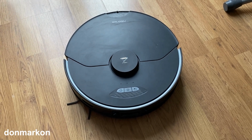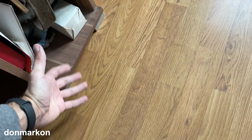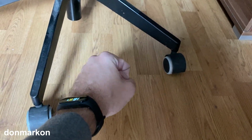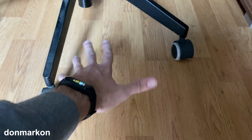Here is a simple example. When it was going around the corners of furniture and so on, it would keep too much distance, around 1 centimeter. It wouldn't hit anywhere, but that was not practical overall. Also, it had problems with the areas around chairs. A regular robot without a 3D camera would just go maximally inside, and when the front bumper activates, it realizes it has an obstacle in front of it and stops, but it cleans the maximum amount of space. MaxV didn't do that. It just cleaned like this, and it was moving out. Now it goes deep, 99% like regular vacuums, but without hitting anything, which is really good and really practical.